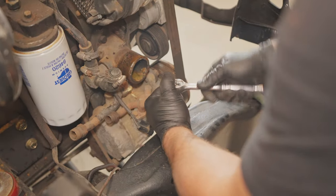That's something there. I think I'm below the master. So that would go there. It'd be helpful if I could drop that down, and I could, but nah, I couldn't. I'm just gonna drill a hole basically right here and mount this thing. It's gonna be temporary, but it looks like the brake lines will go right to it. Is this actually gonna work? We got it mounted. Now hopefully the brake lines will fit up here. This might work. I wish I'd get a little lower, but it is what it is.